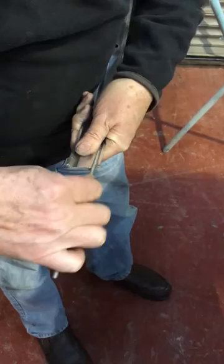Next, go to the front of the vehicle and do the remaining front door, and repeat as previous. You can now repeat the process on the long side panel, remembering to allow the 2 millimeters at each end for both end caps. It is important that both the left and the right side trims are positioned symmetrically, as the rear door trim will not run parallel to the body moulding if there is a discrepancy.